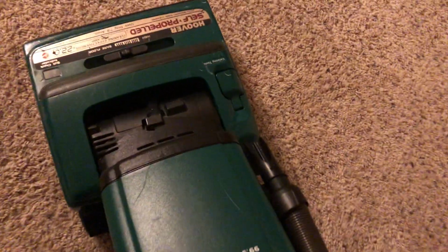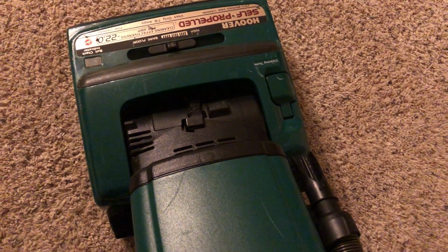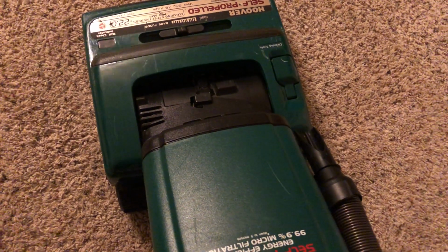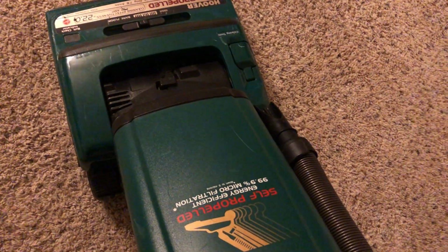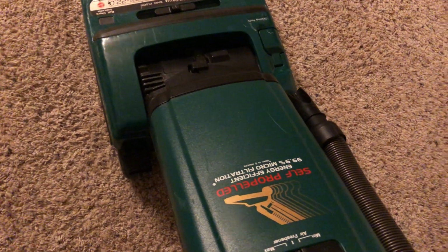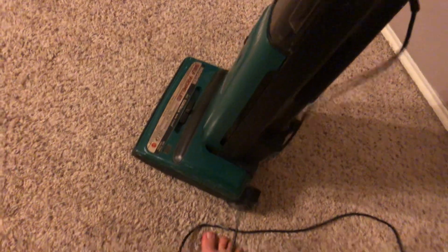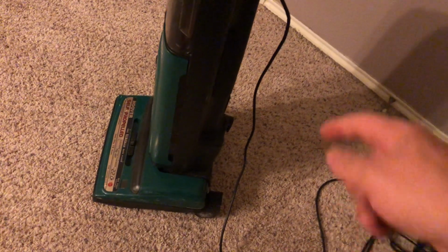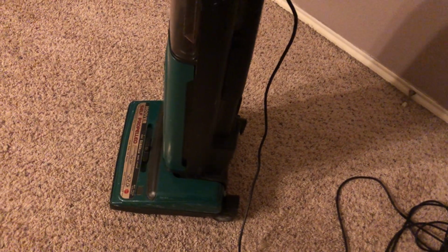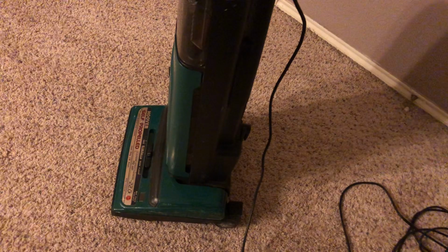One thing I would like to point out is the fan in the motor in this is not original. This is a retrofit 20-blade fan impeller that I put into this, simply because it changes up the sound of the motor quite a bit. You have to keep in mind also, since this machine is part Concept and part Elite, the lower base is a Concept, but as a modified upper dimension body, it still has an Elite style motor inside of it. And the fan part number for these is the same as a non-self-propelled Elite, so even the 20 blade retrofit fan will fit this.